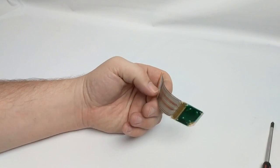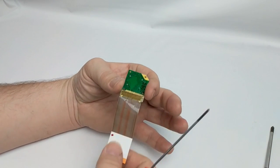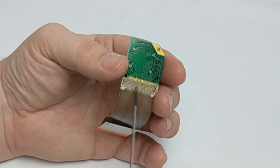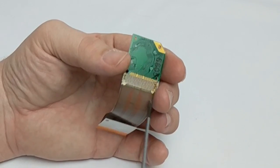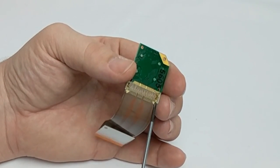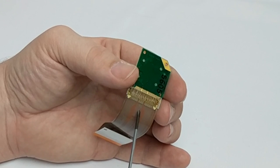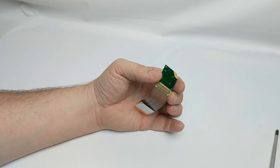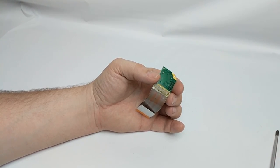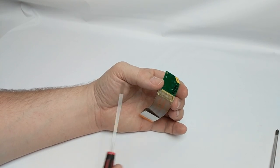This is the cause of all our problems — this is the actual lens assembly itself. What happens over time is this solder joint here — this cable — fatigues out and eventually starts pulling away from the board. So what we need to do is essentially reflow the solder that's connecting this connector to the board. Some people like to throw the assembly into an oven to reflow, but I'm not a fan of that because you need to apply direct heat to the specific spot.